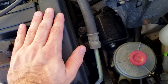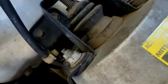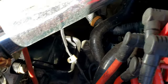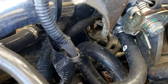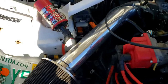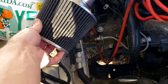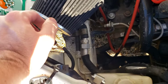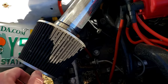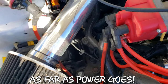I'll bolt the torque dampener to the frame so when the motor torques back and forth it's controlled. I have 1320 polyurethane motor mounts and brackets - I haven't had any trouble with them yet. The vibration is nowhere near as bad as you'd think - it's actually pretty decent. I do have a short ram intake, just a cheap eBay one from an EK chassis. I've noticed better response from it being a short ram - it has more area to flow and it's not really getting that hot in this location.